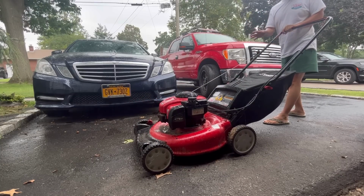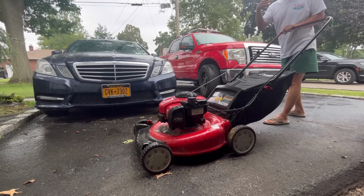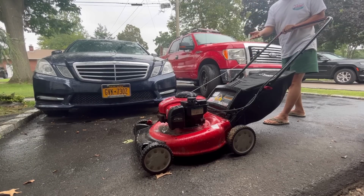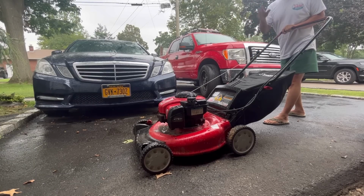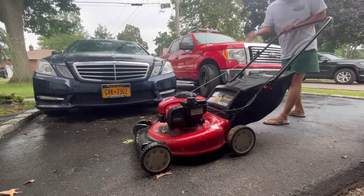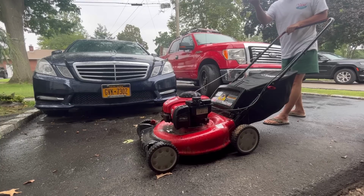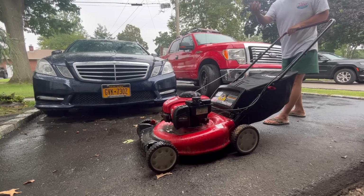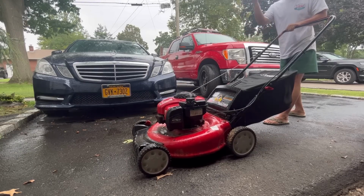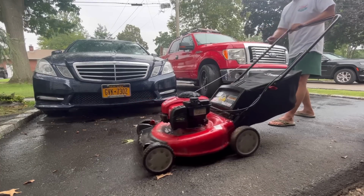Why do I pull it so many times? Because each pull creates a vacuum and sucks up gas where gas isn't allowed to go. And if gas wasn't there all the time, the gas that's there now loosens up rust, corrosion, ethanol, and maybe it'll dissipate a little and move. Then you can go like this. If the float is stuck, the needle is stuck in the hole and the float is stuck too, doing this may jar the float down and allow the fuel to now flow. Maybe. So I give it at least 5 to 10 pulls. You just never know.